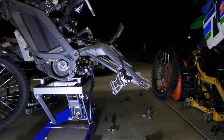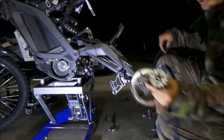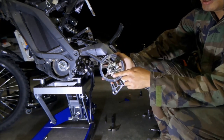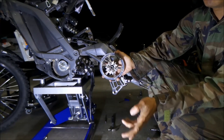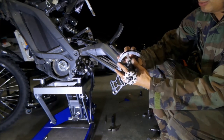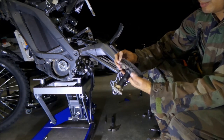Go ahead and get your jack shaft out. I just changed the sprocket on it - the counter shaft sprocket. If you want to learn how to change this sprocket right here, I made a separate video for that. It's not hard at all, but it's one of those things where you're already there, so let's just go do it. Don't forget to inspect your sprocket or pulley to make sure it's still in good shape. This one is still in great shape.